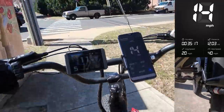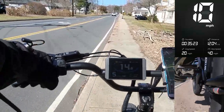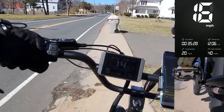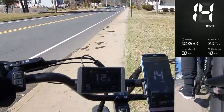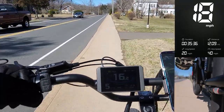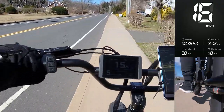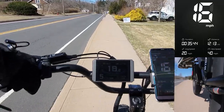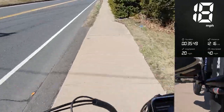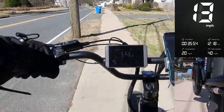Call that gear the downhill gear. 60 teeth in the front to 11 tooth in the back. You probably won't use that all that much on level road unless you weigh maybe somewhere around 150 or less, and you're easily getting 35 plus on a fresh charge. But otherwise, if you have a slight downhill and you want to actually go as fast as possible, we'll call that the downhill gear. And I'm digging it, guys.